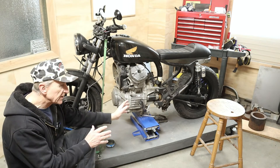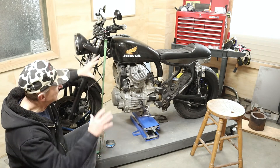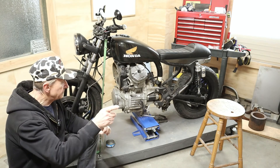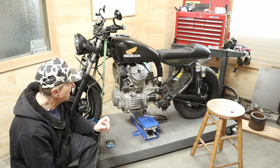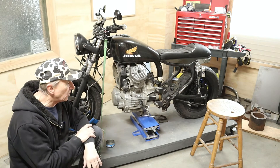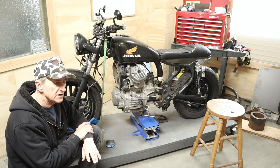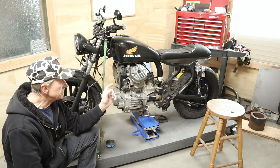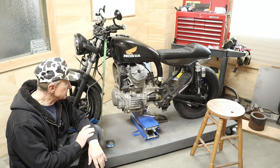It'll probably go back on for a little bit, then it'll come off. When everything's done, disassemble the bike completely. I've got a big bead blaster, sand blaster next door in the dark side, which is becoming the light side very quickly. We'll throw the frame in there and bead blast and clean the whole frame. Then I'm going to epoxy paint the frame because I have the ability to epoxy paint it here. And if I make other changes, I can easily epoxy paint areas and not have to send things out for powder coat.